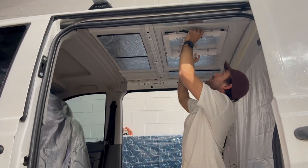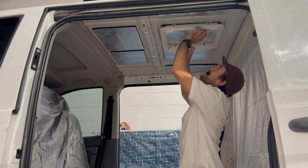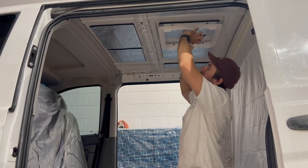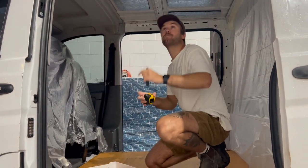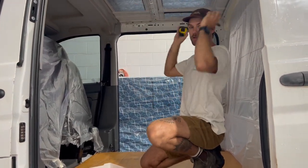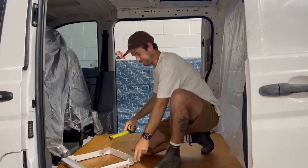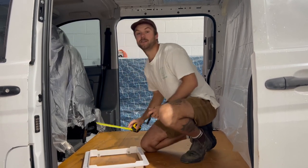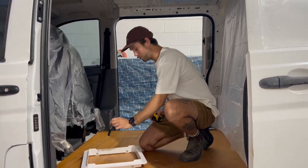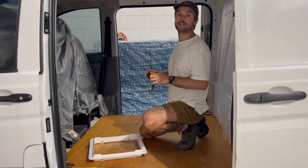Basically, so I'm gonna mark up and lock in slightly where I'm going, and then I'm pretty much just gonna measure off this rib that's parallel the whole way down. And I know there I'm at 60, and I've got 347. So what I'm gonna do is center that, do a pilot hole through the middle, so when I jump up top, I can easily measure it, start cutting it out.